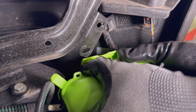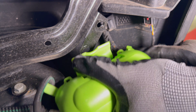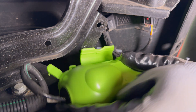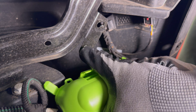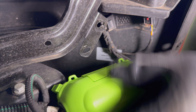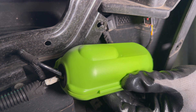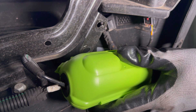It's a little tricky, but as I close it I'm going to make sure the wiring stays correctly in the grommets. Once you get the wires inside the grommets — the rubber gasket, basically — on both sides, then you press it closed. Pull down on the latch here and that will lock it in place. It will snap fully. Then there are two auxiliary ones on the edges you'll snap down for extra protection. Now we have everything wrapped in this enclosure and it is now going to be watertight. If you ever have an issue with the connector, you can easily unsnap this enclosure and access the wires underneath.